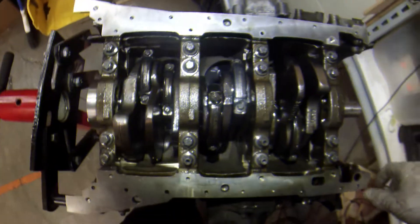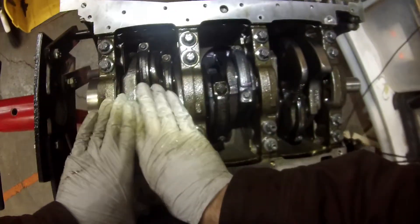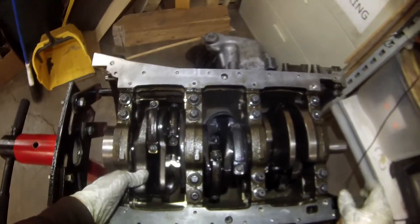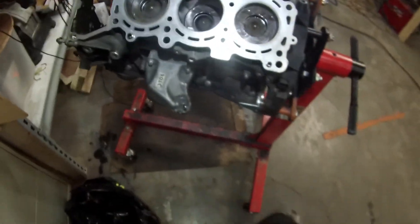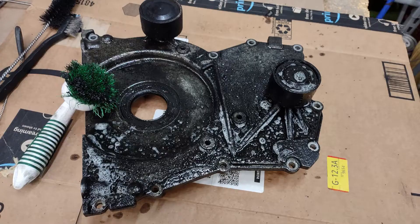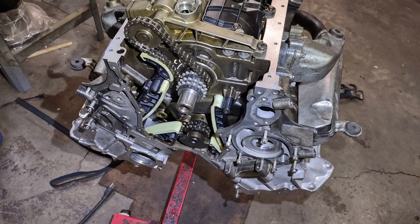I know we're starting to go a little long here, but it's important to show you the piston squirters. You'll need to check these, especially if you put a new piston in. I think mine got a little bit bent and the new piston is shaped slightly differently, so I needed to go in and actually pull that piston squirter back out and adjust it so that it cleared the piston. Just be sure before you button it all up that you check all those squirters and make sure they're not impacted. Now we can see all six pistons are installed and the block and the rotating assembly is ready. That's all I've got for this time, but next time we'll lap some valves, replace some valves, get some new parts, and bolt the heads on the engine. We're making really good progress and it should be running soon. Can't wait to see you next time.